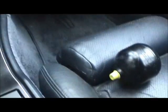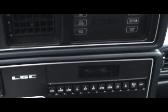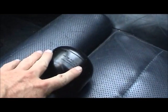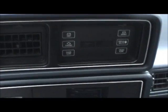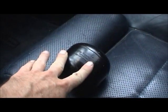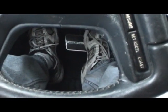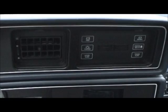Hopefully this video was helpful. These first-generation anti-lock brakes with the hydro boost on these cars are very reliable and don't really give you a lot of trouble. But it is one of the Achilles heels to these cars because the components are very expensive — it's just not something you can run down to AutoZone or Advanced Auto Parts and buy like a regular master cylinder or vacuum booster for a traditional car. But it is possible to fix these things, get them functioning to OEM specifications, and get rid of that troublesome brake light, as well as regain the functionality of the anti-lock system. The anti-lock system is not going to work if it doesn't sense that it has enough pressure built up to actuate the calipers back and forth. So parts are a little bit hard to find, but definitely well worth it to get the system back up and running.